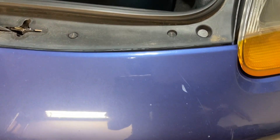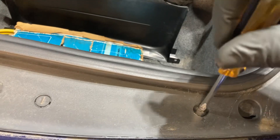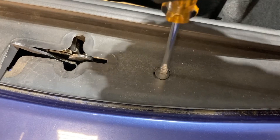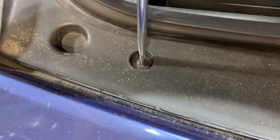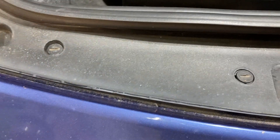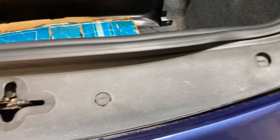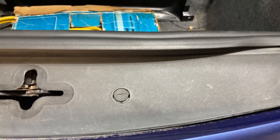The bottom of the bumper is all loose. These are just little quarter-turn fasteners. They should come loose with just a 90-degree turn like this. It should come up now — I might need two hands to pry. There we go, little by little. I'm going to put the camera down, but those are the quarter-turn fasteners.